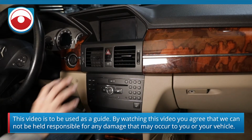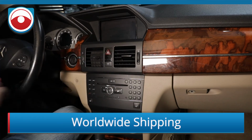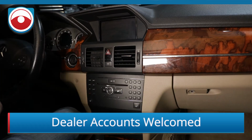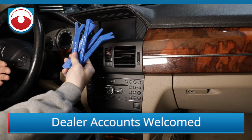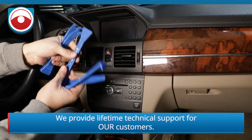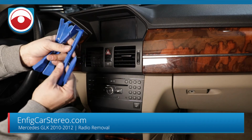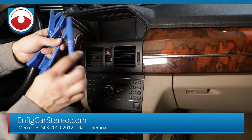All right guys, so the first part of taking out this radio is getting out this part. This part's a little tricky. On this car, you're going to use a panel tool set. I recommend getting the whole set for this car. You'll probably only need 2 of them, but you might as well get the whole set. This is a PPT 1, 2, 3, 4, 5. So it's basically 2 pry tools, depending on what you need it for. This is a scraper, but I use it for a lot of different things. This is my panel popping tool, and this is a bone tool.